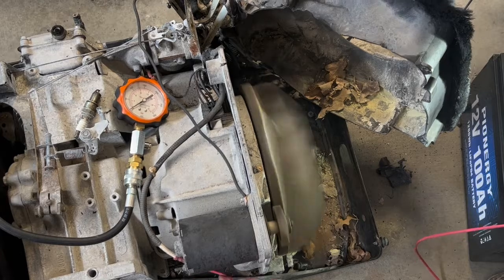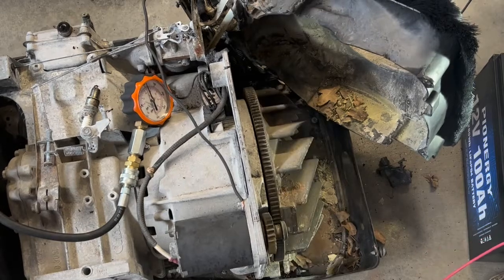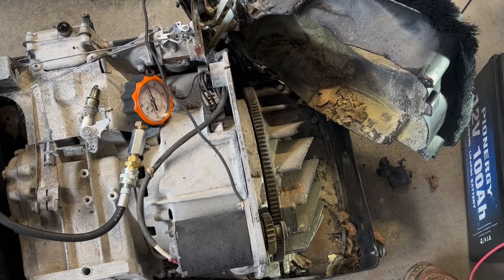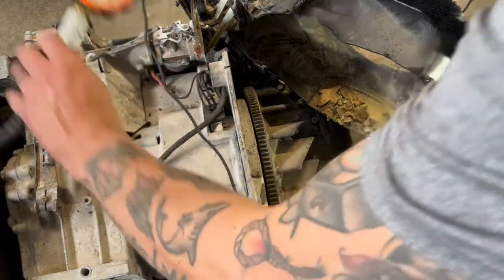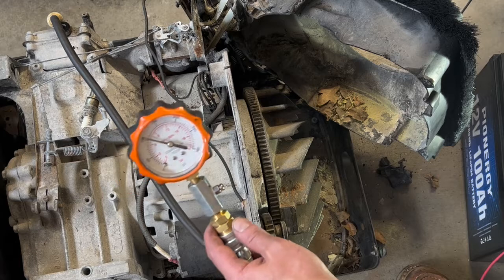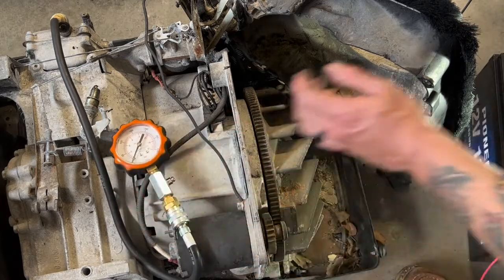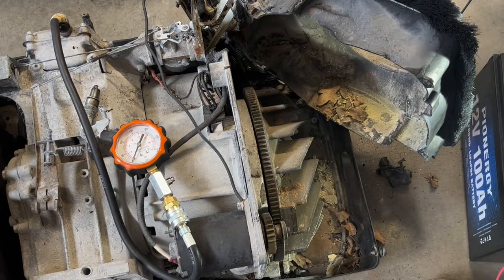I think I saw it go over 100. We're maxing out just about at 100 PSI, which I think is good — a number I can live with. I'll show you guys the gauge. Just over 100. I think that's good; I have no reference, but it's good enough to make me want to use this engine. Debris did fly up everywhere. Now I can message the guy that this is going to, let him know that he bought a good engine off Craigslist, and we can move forward with the repair.